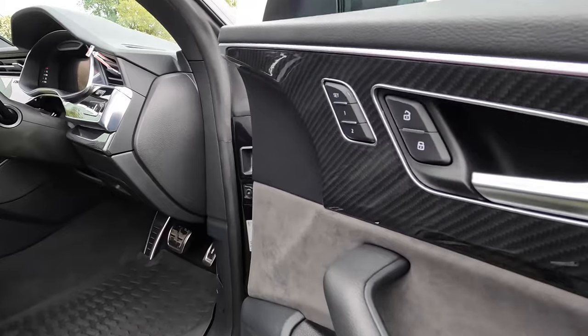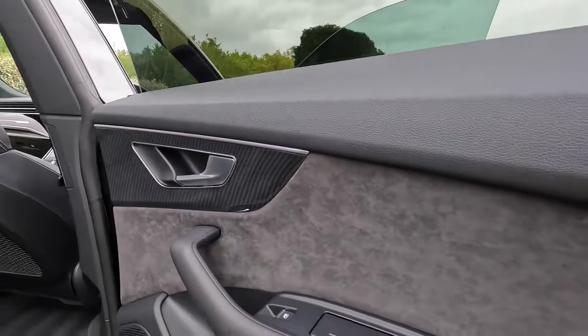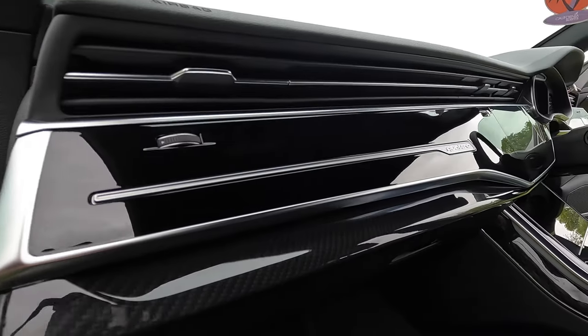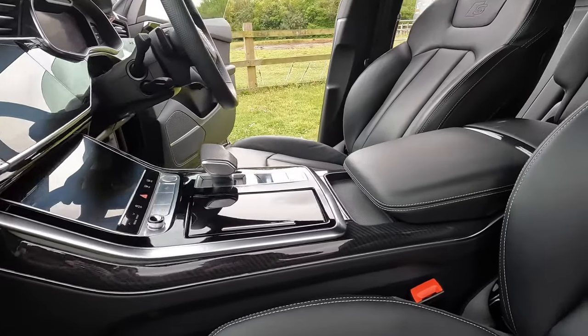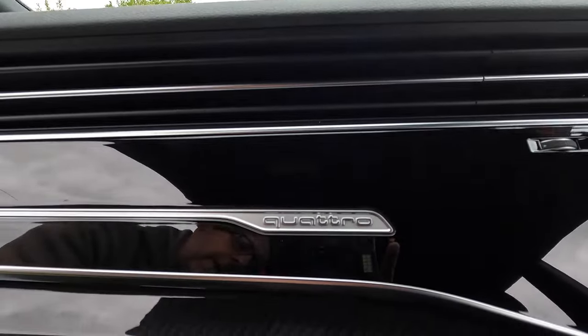But the main thing we have done, which the whole video is focused on, is of course our hydro dipping. So we have stripped all the interior trims that were in the silver. So that's dashboard trims all out, door card trims, centre console, and everything has been fully prepped, repaired because it had minor scratches over everything, then painted in the required grey, then hydro dipped in the carbon effect, and then of course everything re-prepped and then done in a lovely gloss lacquer, everything polished and then fitted back into the vehicle. Of course then we've given the interior a clean, of course, to finish. Really makes a massive difference to this with the carbon interior instead of the silver, that just finishing Black Stag touch, of course.